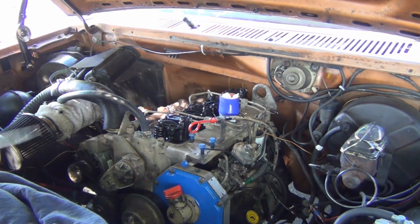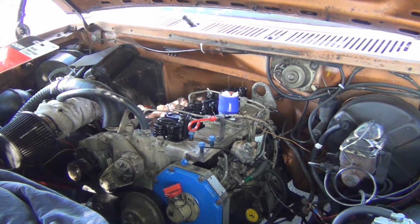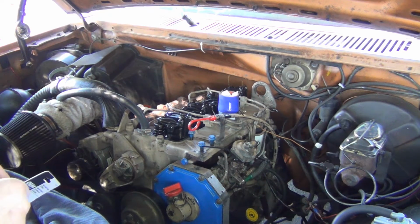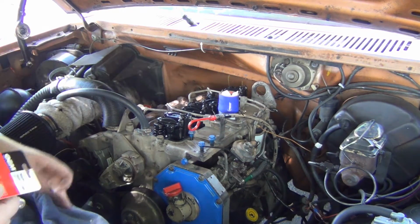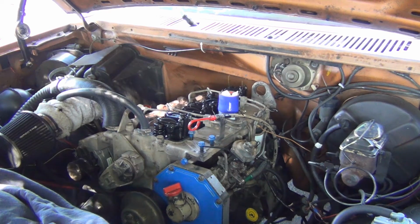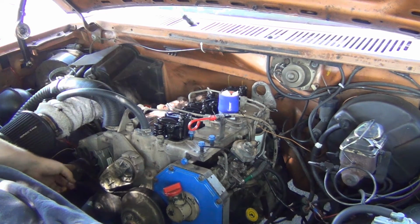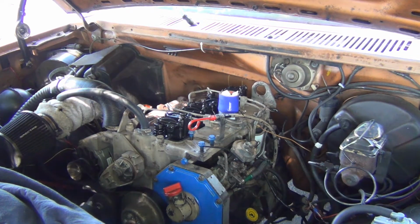Intake is 10 thousandths of an inch. So, exhaust is 20. That's exactly what I thought. And I'm pretty certain our exhaust, this guy here, I mean, why would that be? No, yeah, this is intake because it's closest to the injector. So, I don't think this is going to work. I wonder if I can put a nut on here and that would actually turn it over, because it's a small pulley, it's going to turn a big pulley. We might get lucky there.